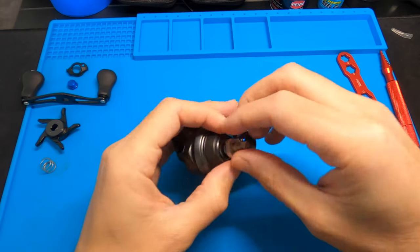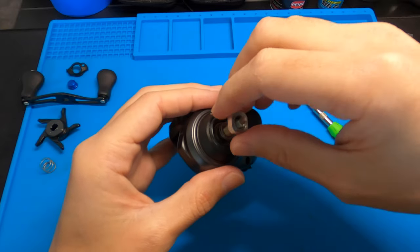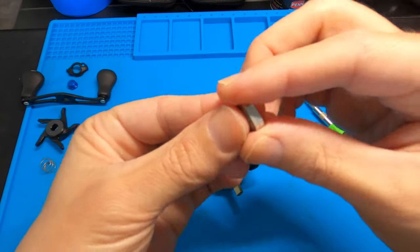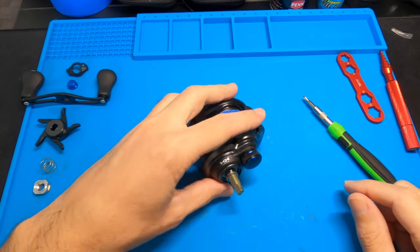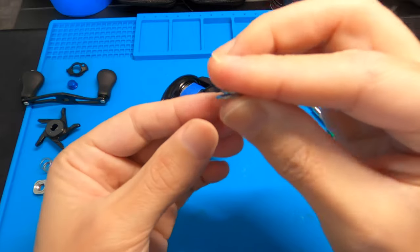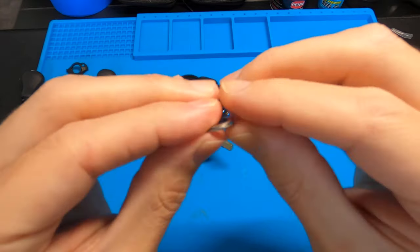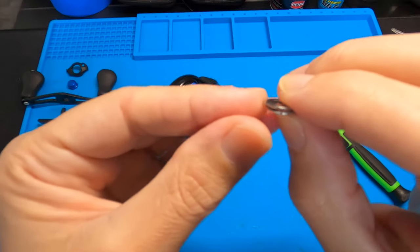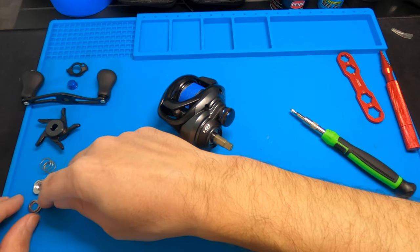This nut spins off to the right. Right underneath it, there is a washer that likes to stick to it. I like to keep that on and place the nut right on top of that washer so I know the exact way it went on. Next up, you got these two spring washers — take those off and keep them in the exact order they were on. This is about the tension in your drag star. They came opposite each other, giving you a little space, but you can flip them and nest them the same way if you want less or more tension in your drag star.